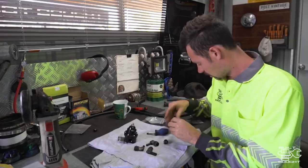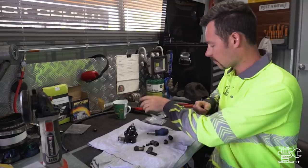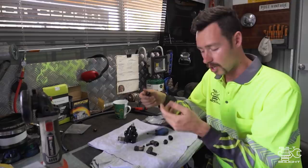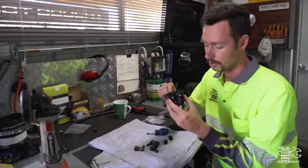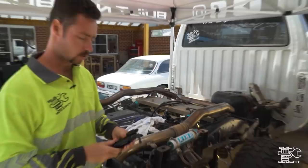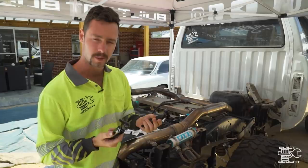What we're going to look at now is basically all these fittings for this regulator. When it comes to fuel systems, everything you use with these kind of connectors are what's called AN fittings — they're anodized and precisely machined, so a lot of these joins don't need seals or O-rings; it's just the flush fit up to the connector. I'm reusing the right-angle fittings from the old fuel system and I've got some new male-to-male adapters which do have an O-ring because that's what this regulator takes. And I've now spent over $200 on those AN fittings — performance parts are basically a tax on top of whatever else you want to spend on a car.